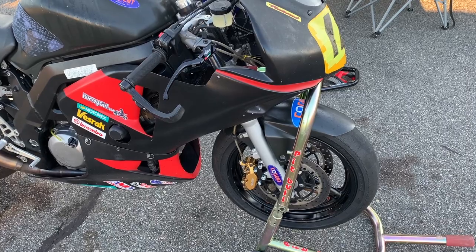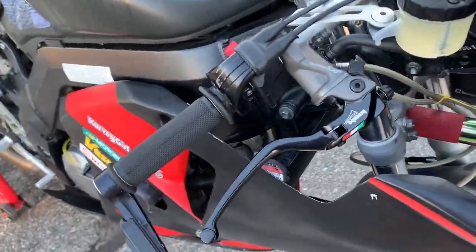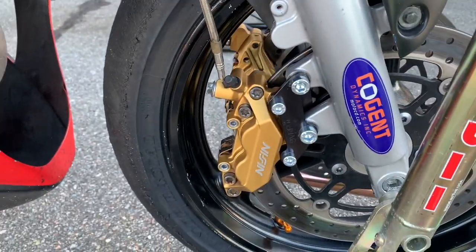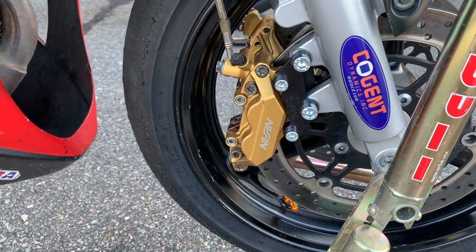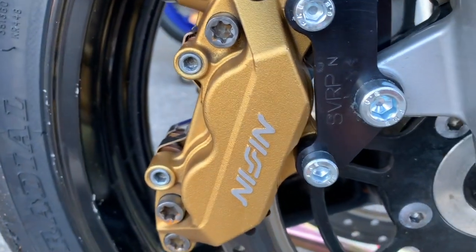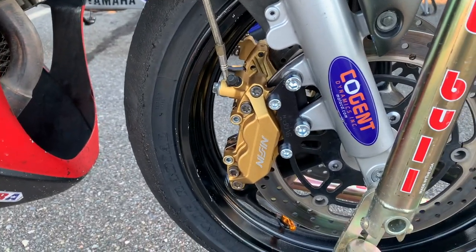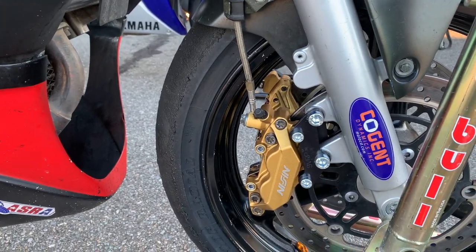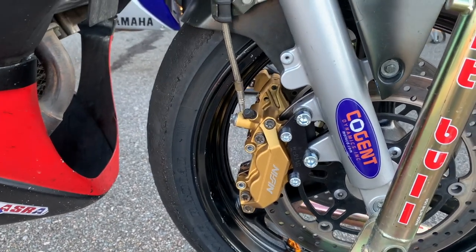Here's the final setup of the brakes. Got the Brembo master cylinder, got it bled, everything working great. Pro tip: make sure the SV Racing logo is facing outward on the bracket. Will it go on the other way? Yes. Will you be able to turn the wheel? No. So I had to go back and take everything off — everything had red Loctite on it, so that was fun. But everything's good now.